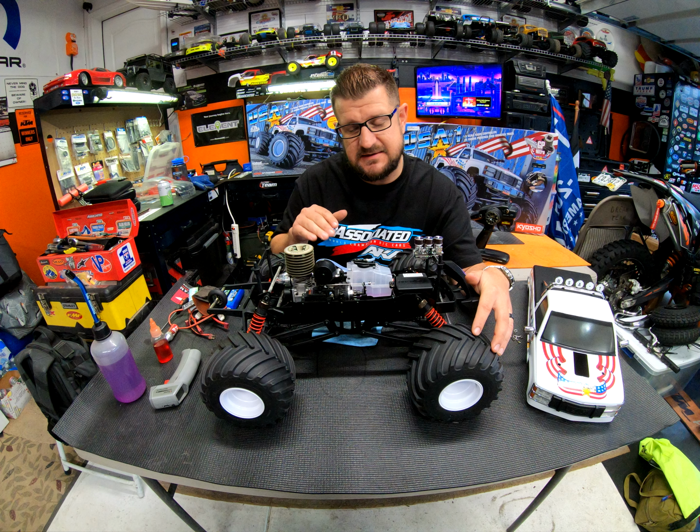So again, it's idled the first tank, and I'm letting it cool back down. I've got the piston out of the pinch area, which is the perfect thing for break-in. I'm going to let it finish cooling the whole way. I'm going to complete the other three tanks of idle break-in, and then once I'm ready to start driving it around on that fifth tank of fuel, I'll bring you back and we'll go from there.